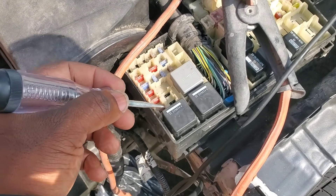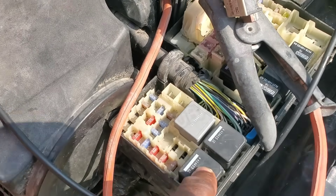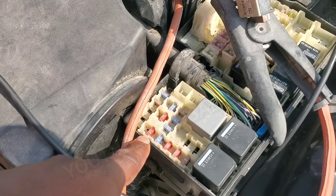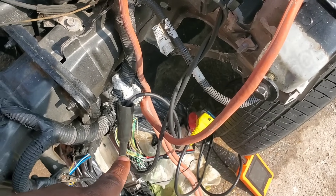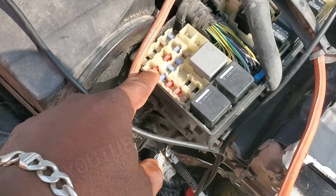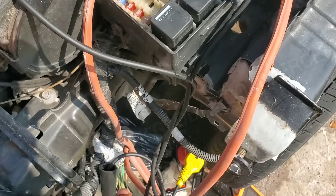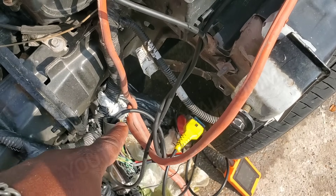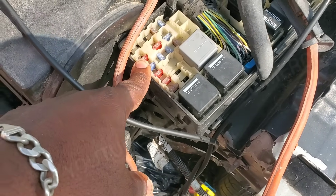There's something going on. Looking at the diagram, this relay powers this fuse, and this fuse then sends power to the gray and yellow cables to power on the engine computer. So I think a good course of action is to test voltage at this fuse — that will tell us if we're seeing the same low 10 volts we're getting down there, or if we're going to get full battery voltage at 12 volts up here.